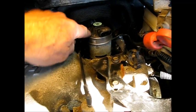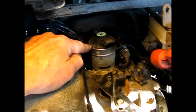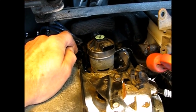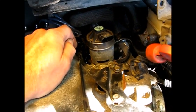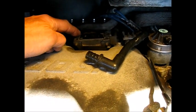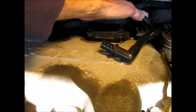I was planning on taking out this EGR valve here, but the way this car is, with the small opening in the hood, there's very little room to get at the bolts. So I think what I'm going to do first is take out the MAP sensor — manifold absolute pressure — and the coil assembly. Then maybe there's going to be a little more room back there to get at these two 10 millimeters.